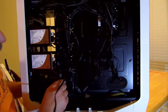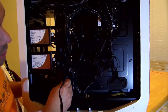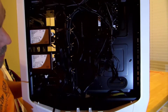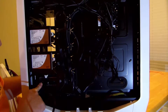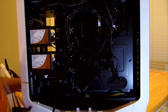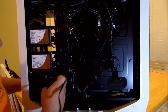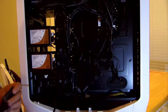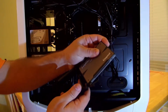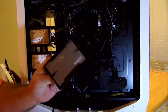This little clip is in the way, so I'm going to go ahead and move it to about right here — that's out of the way. Push all these other SATA cables in, and this is what's going to be plugged right in here, just like these guys have, and Corsair does a great job of it. All you do is grab your SSD, slide it into the tray, it clicks in place, and there — you've just plugged in your SSD.